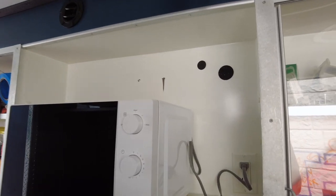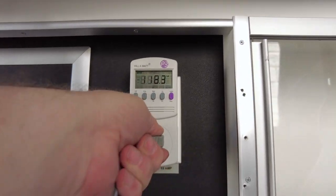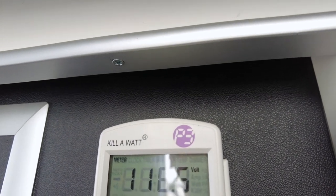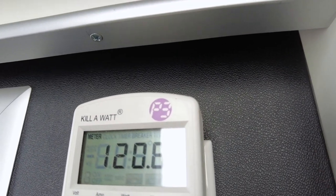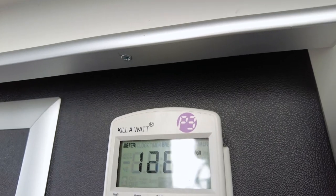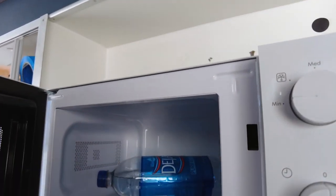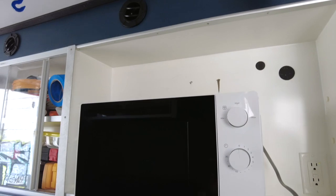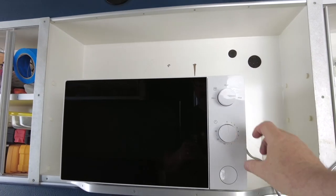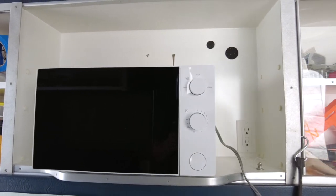So we're going to have to do a test. Let's start with the IKEA. I'm going to plug it into the Kill-A-Watt. You can see we've got variable voltage — I don't know what is up with the inverter in this thing. I mean, it's 11 years old, it might be beat. You can hear it buzzing, but even with virtually no draw it's jumping all over the place. We're going to give it a try anyway. It's not good to run a microwave without a load, so we're going to put this water bottle in here. Let's try it on max and see what happens. Loud buzzing, which is normal for a modified sine.